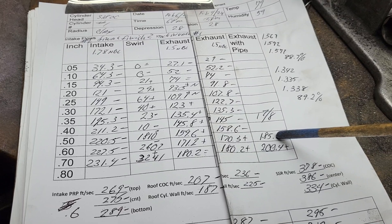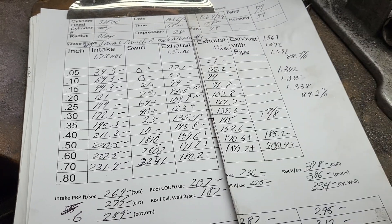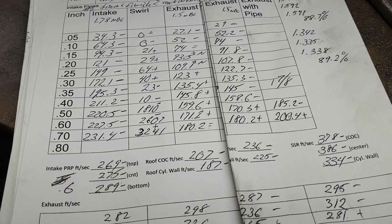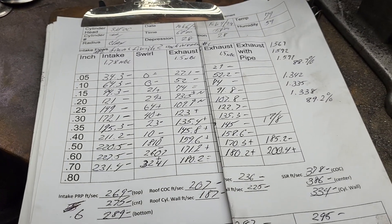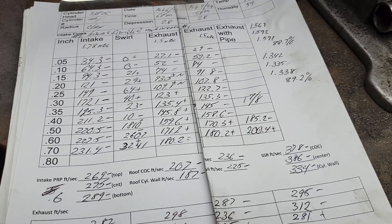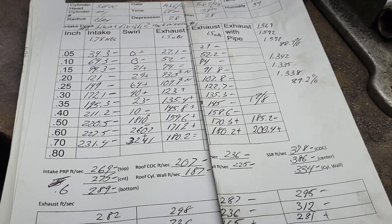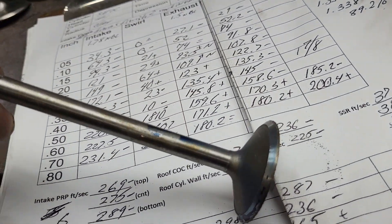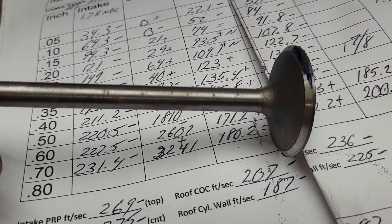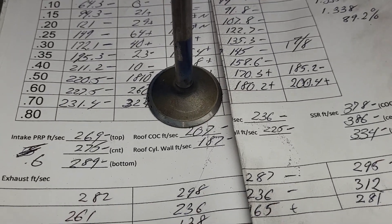Let's take a look at our inch and seven-eighth pipe: 185.2 and 200.4. It's a little bit better at 600 and a little bit worse at 700. Is it worth giving the exhaust valve a nicer shape? It'd be nice if we had brand new valves — that would be even better instead of older pitted stuff. I'm sure the pits don't really help much. If these are going to get spun as hard as I think, we probably need to get a set of exhaust valves. I have a set of new ones, but they've been sitting around a long time and they do have a little bit of light rust on them.